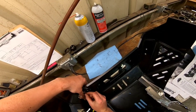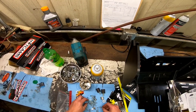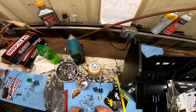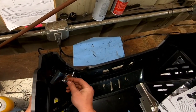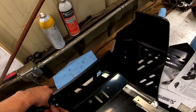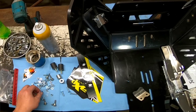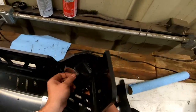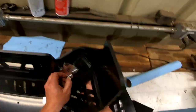Let's start getting the AXP skid plate ready. The bracket with four holes goes on the left hand side — you can only fit it one way. If it feels like there's a slight gap on one side, you need to flip it around. The bracket with five holes will go on the right side. Just put the bolts in and make sure everything is hand tight for now.